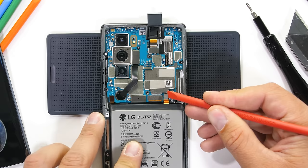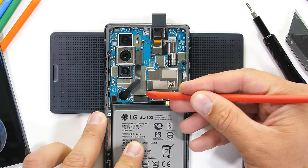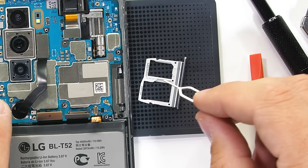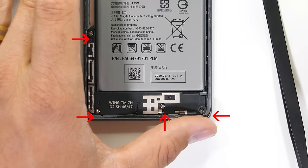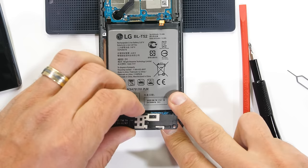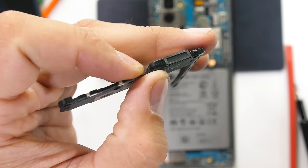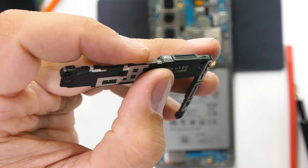I'll disconnect the battery, the bottom screen, and the USB-C charging port cable — all just like little Legos. Then I'll pull out the SIM and expandable memory SD card tray. You might think that a phone like this wouldn't have any water protection, and you're kind of right. The phone isn't exactly sealed shut, but LG has coated the internal boards with a water repellent coating. There's still no official IP rating, so keep it away from water, but it is nice to know it does have some protection.